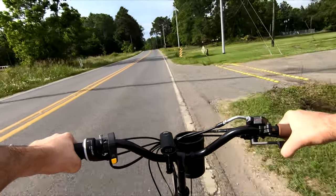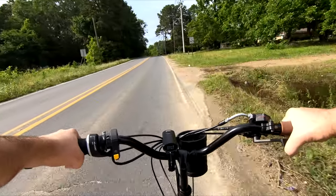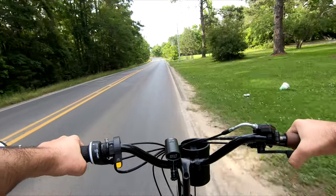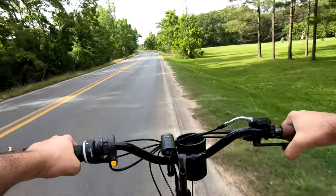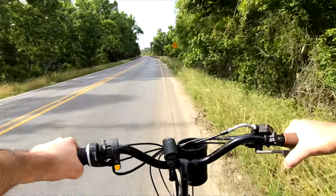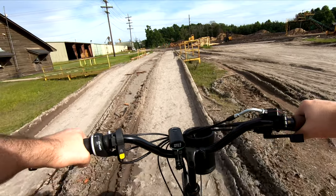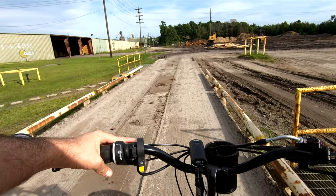Right out of the gate I can tell the bike still needs some work. First, it's running a little rough because it's running very rich - at pretty much all RPMs except wide open throttle we can hear four-stroking. However, the modifications are a pleasant surprise. The handlebars are very comfortable but do need to be raised a little bit. And the suspension seat post - at first I didn't know what to think about it, but I assumed it had a break-in period, which was correct, because during the first ride it was a bit stiff. When it would break loose during a bump you could feel the suspension, but then it would stiffen back up again. We gave it a few days and then we'll come back to our thoughts on that. Everything else on the bike feels good.